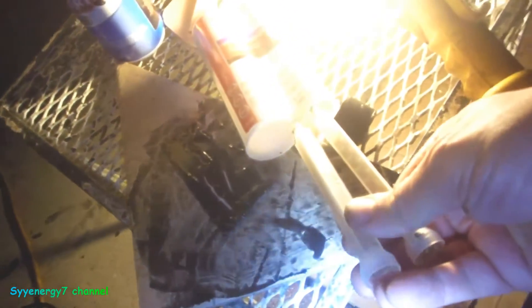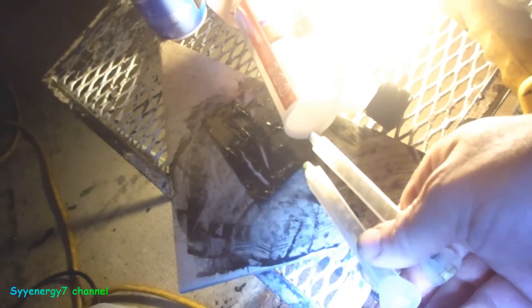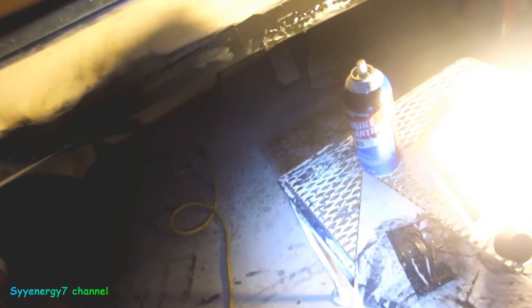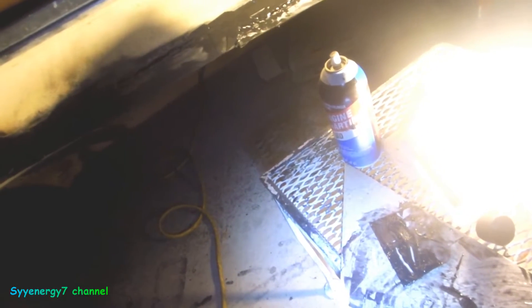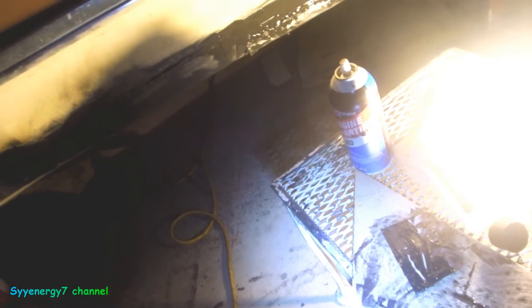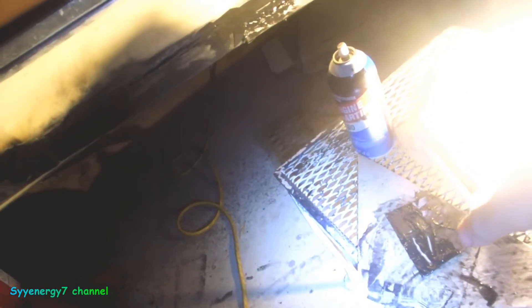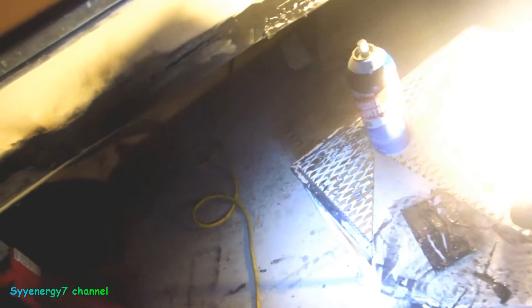Then I put a skim coat — just mixed it up like plastic Bondo. The way I use this is I'll put the squeegee up against my chest, or some kind of piece of metal, and just squeeze the contents out evenly onto like a piece of tile or a mixing board. I mix it up like Bondo plastic. The thing is, you got a lot of time to work with this stuff — it's not like working with plastic where you've got 20 minutes max. It takes 24 hours to dry, so you can mess with this stuff for a good 30 minutes easy. It's not ready to be sanded for maybe a day.